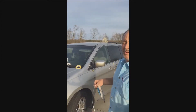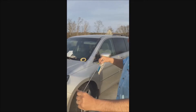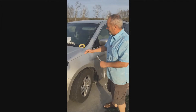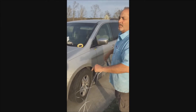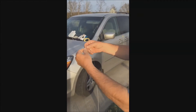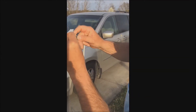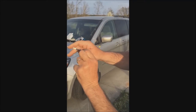Matt here just showing you how I stripe cars — I've been doing it almost 35 years. This is a two-tone pinstripe, so I can't just let it off and start striping off the roll like this. I have to make sure which color I want, top or bottom. I usually just do forearm length, a little bit more — that does most vehicles. We break it off and get it started. Otherwise you can be sitting there going, how do I get this pinstripe started?